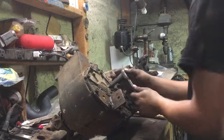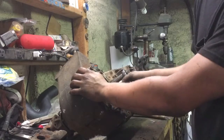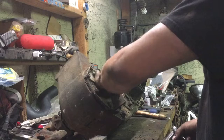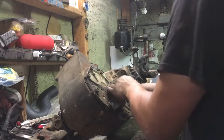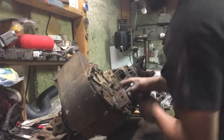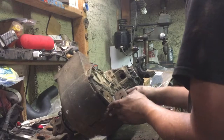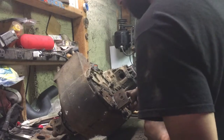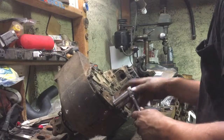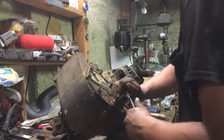And the 205s are all gear driven. That's the main advantage of a 205. A gear driven case is going to have no chain slack. You cannot break a chain. You can damage a gear, but it's a lot harder to damage a gear than it is to break a chain. Similar reason why diesels usually have timing gears versus a timing chain, even though there's a lot of stuff driven off that gear train and a chain would be a nice, simple, easy thing to do. They will actually opt for timing gears just for that extra added durability.